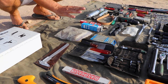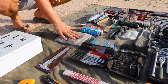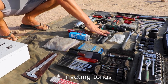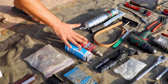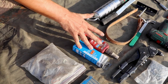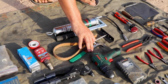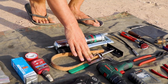Screwdrivers, allen keys, and a set of bolts, nuts, and washers so you can fix something temporarily when you don't have the right bolts at hand. Rivets and the tool for them, because the Defender has a lot of rivets around. I didn't want to go without a universal seal that's oil-resistant and high-temperature resistant. Also Loctite, sealing tape, and a strap for the oil filter — that's a little difficult to get to on the TD5.